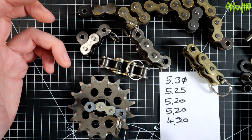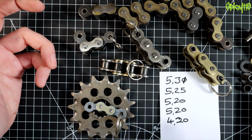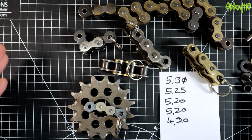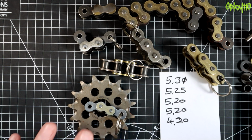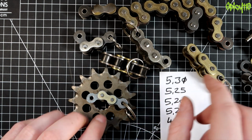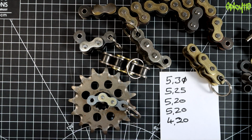As I say, if it's like a 125 to a 250 and you've got a 520 on it, you're going to be fine. But if you're doing something silly, then you might want to go to something quite a bit beefier. You can't, as I say, just put that on the old sprockets. You just buy sprockets which fit your bike but are thicker, and then you get the thicker corresponding chain. So you need to make sure that the chain and sprockets are the matching set.